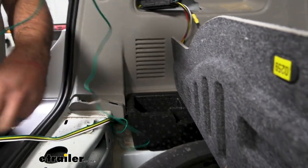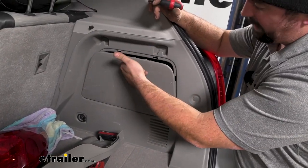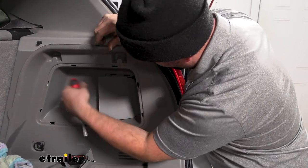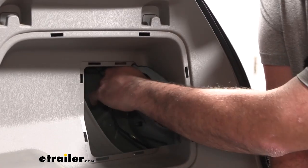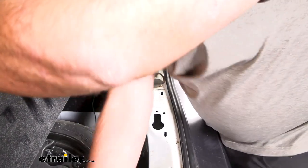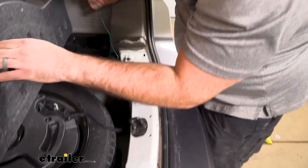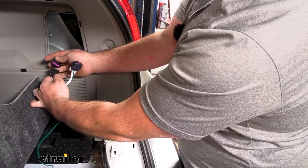We are going to take some panels off to plug this into our taillight. On the passenger side it's going to be pretty simple — just pull this back, and we have a panel very similar to the driver's side. Now we have access to our taillight plug. Just as we did on the driver's side, peel back that gray plastic clip and get this separated. We're then going to pass our green wire through a very similar gap to what we had on the driver's side, route it up to where we can plug it in. The plug obviously matches the OEM one, so just go ahead and plug it into the other one, and this will go into the taillight.